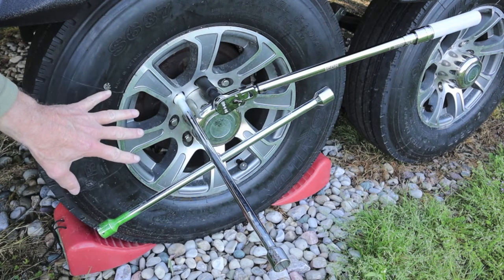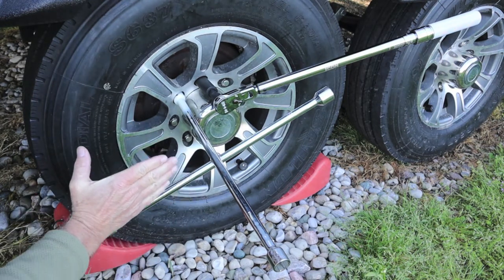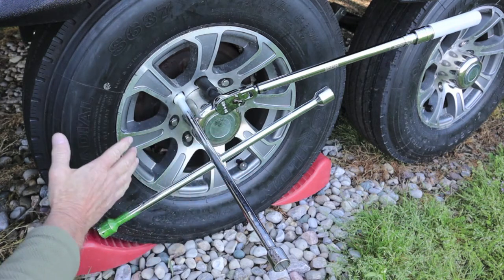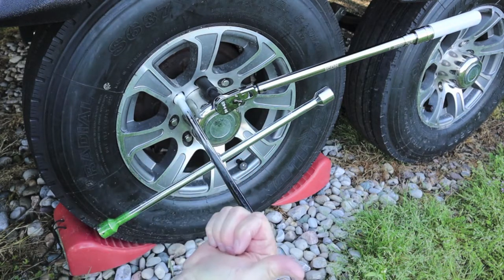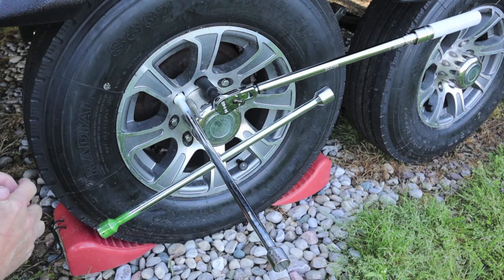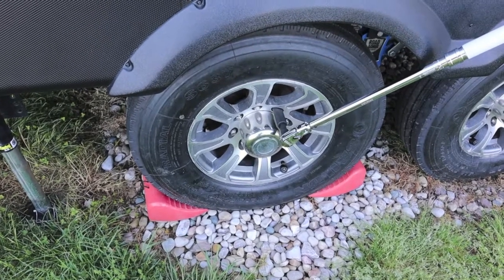When you turn these trailers, watch the action of the tires and wheels. When you turn them 90 degrees and get into a really bad bind, the entire wheel will scoot sideways with no forward motion — dragging on the asphalt or gravel. The front axle will do the opposite. So one wheel is wanting to rip off from the outside, while the other is pushing in against the lugs. That's why trailer tires are so critical to keep tight and torqued — especially with alloy wheels, and a lot of trailers nowadays are coming out with alloy wheels. Thanks for watching. If you have any questions, please ask in the comment section. Have a good one and travel safe.